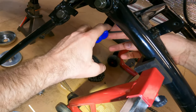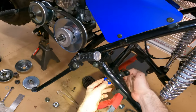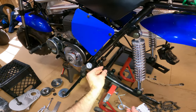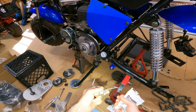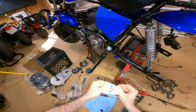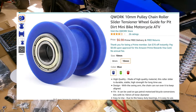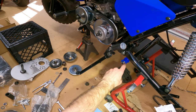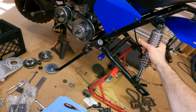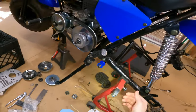I'm going to drill a hole right here, run a spring from down there to up here, connected to this — so there'll be a spring tension pulling the roller against the chain. The kit also came with an adapter for a smaller axle, and it came with a white roller, but since it's a blue bike I got a blue one off eBay for about $6-8. I can't remember if it's the 10mm — they sell them in 8mm and 10mm, I think this is the 10mm. I got an extra in case it wears out. Especially with bigger shocks, bigger sprocket, and longer chain, you really need a tensioner.